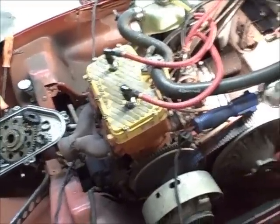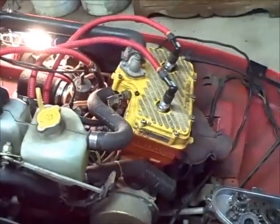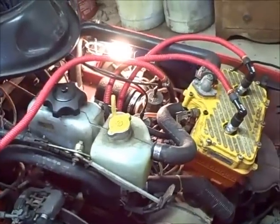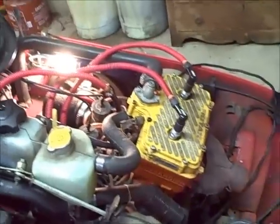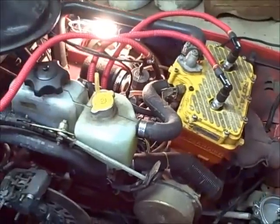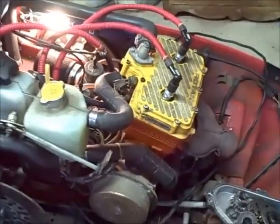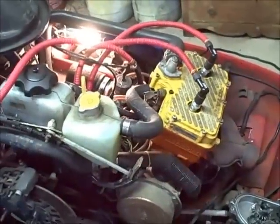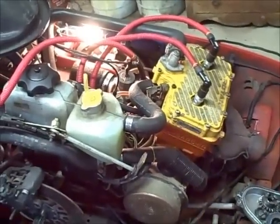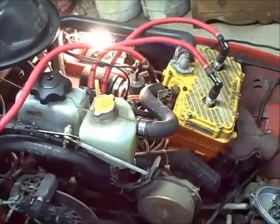Once the engine's completely warm, with that combination of the intake and the exhaust modified, it definitely gave it some more power - probably another 10 horsepower. When I first bought this sled it had a burnt piston and we had to put a new piston in. It would run good until you'd open the throttle wide open and then it would start backfiring - apparently that was the cause of the piston burning. I went through all kinds of different stuff - the CDI box, the coil - I was thinking it was electrical, messed around with the timing. Finally after a lot of work and pulling my hair out, found that it was actually the fuel pump. The fuel pump was supplying fuel - which is what threw me for a loop - but it turned out the pressure just wasn't high enough.